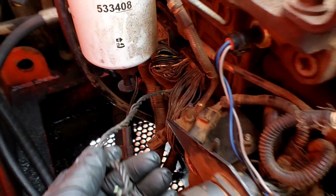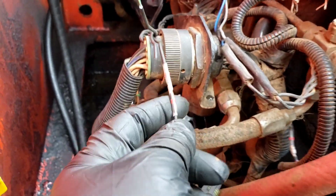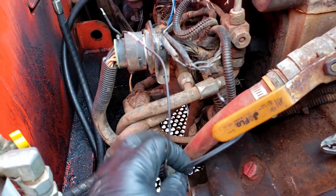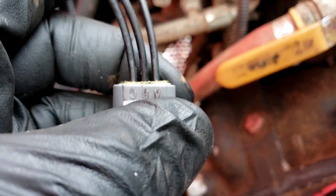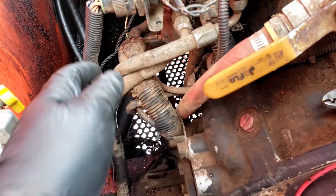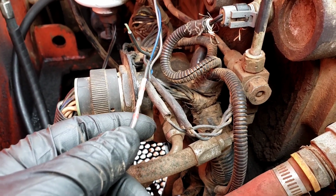Anyways, as I'm cutting the wires to change out and redo the pins for the pigtail that were put on, I found a problem. On the harness, I pulled the harness apart so that we could check the wires all the way back. I cut the two wires off. Our signal wire, when I checked it, let's see here, A, B, and C, right? We're supposed to check supply voltage A to B, and I had 0 voltage, so I checked it A to C, and I had it, which tells me that we've got pigtails in the wrong spot.